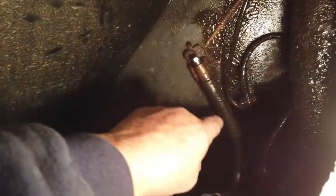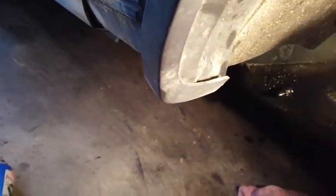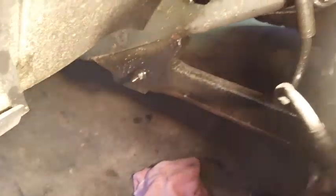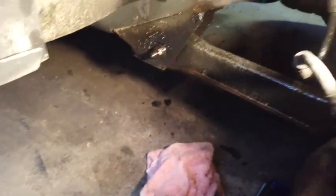So here's what we're looking at. This is where the brake line goes into this fitting, which connects to the rubber brake line. This is the part of the brake line that wasn't all worn out and rusted out. Inside this package, this little piece of brake line right here is the part that was rusted out right where it made that turn. This is the old nipple that it went into, that used to go in right here. The fix is to get a new piece of brake line, which I've got right here.